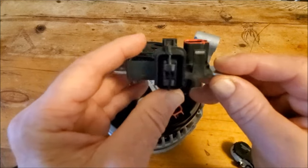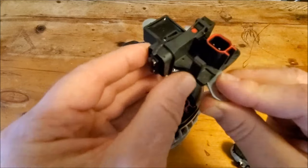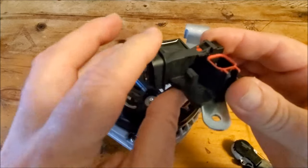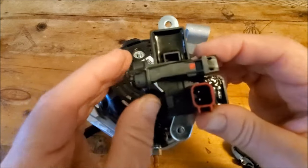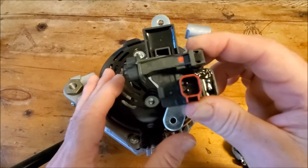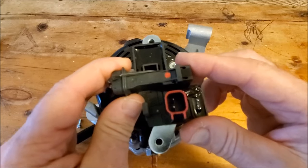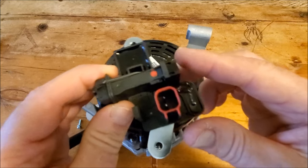Our other kit is for a totally different alternator. These drivers are for Denso-type alternators. The other setup is for Bosch alternators — you can tell it's Bosch because the brush holder is molded right into it and you cannot take it apart. I'll do a separate video on how to set this up on the Bosch 136-amp alternator.